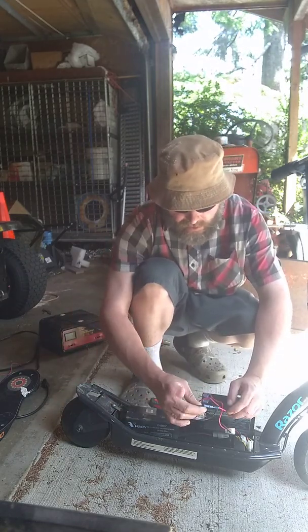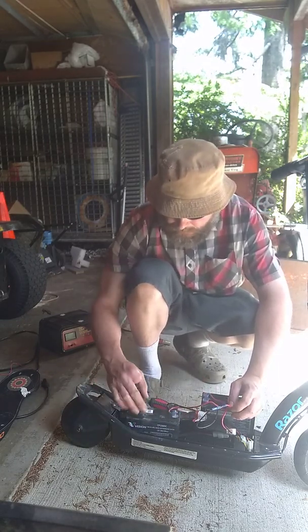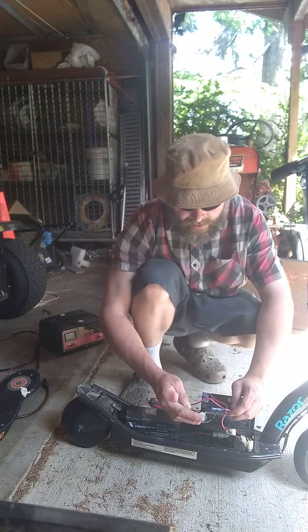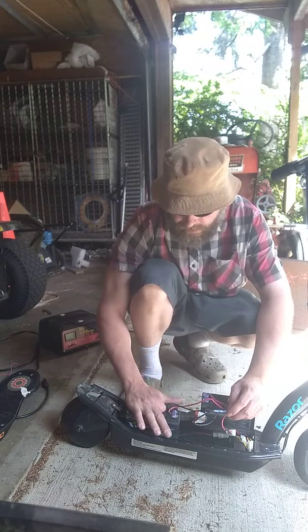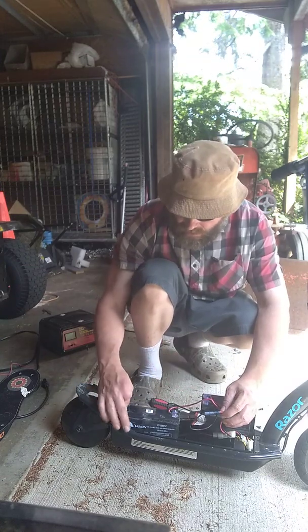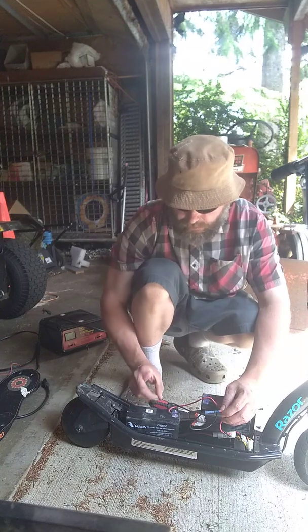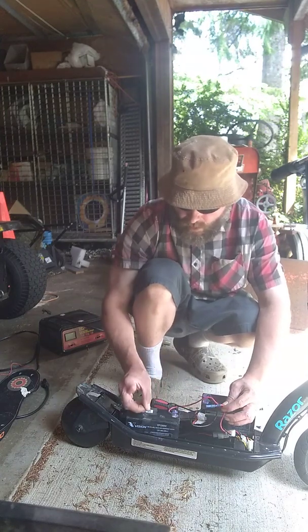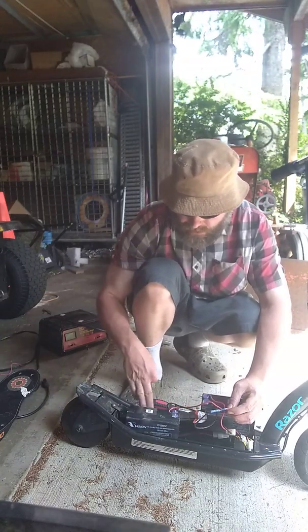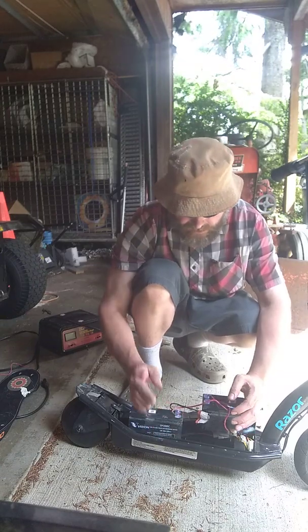This plug-in right here would normally be two plug-ins that go to a fuse over here. We've discontinued the fuse because it used to blow all the time and went bad, so we bypassed the fuse and haven't had any problems. This cord right here would go down to a cord here — you'd have to unplug both of these from one central plug. So the first thing you do is take the red and black that are going to each other and unplug them. Now we've just made these batteries back to 12 volts.